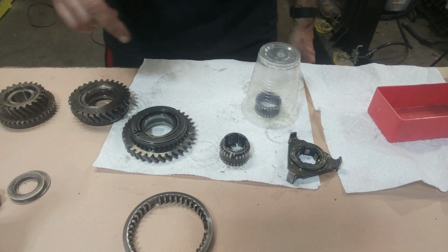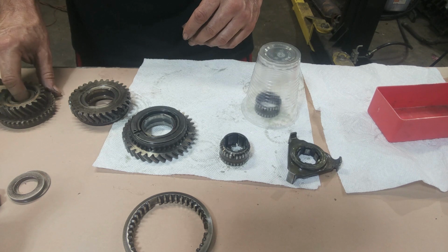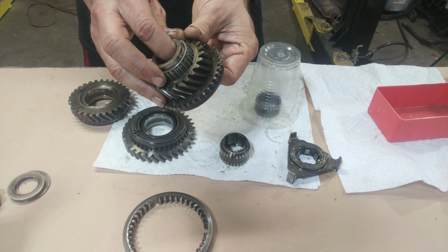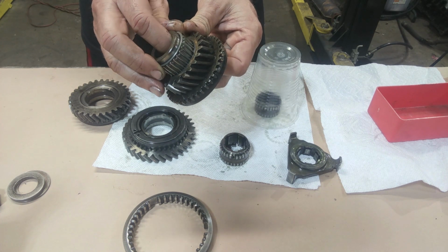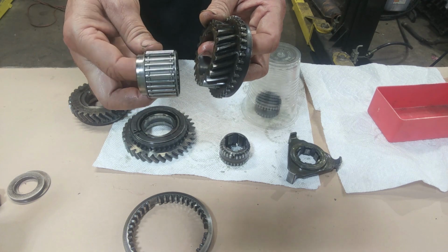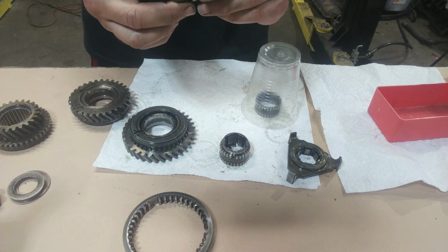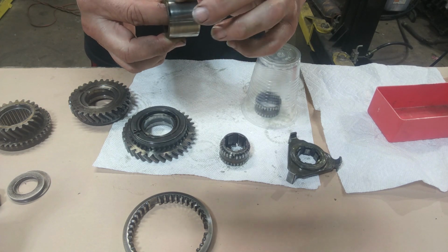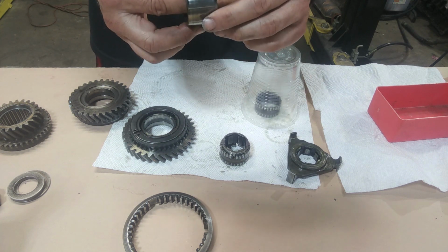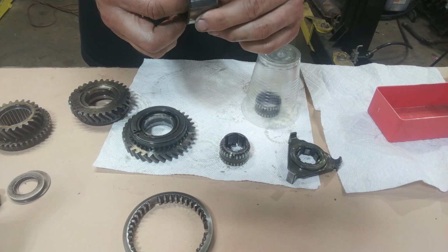And then the other thing that's missing is on this gear right here, this guy, it has a needle bearing too. And look at that, this one's missing a roller as well. This surface looks nice, slightly different in gray between the shiny and the one that's been used, but you can touch it with your fingernail, there's no marks or grooves or depressions in it.